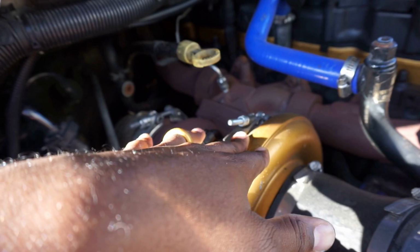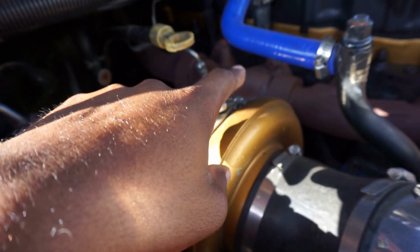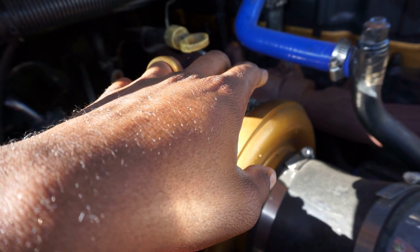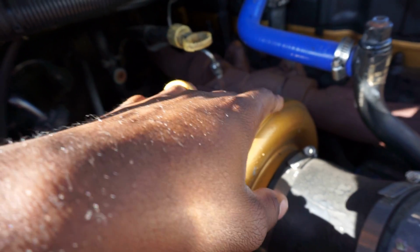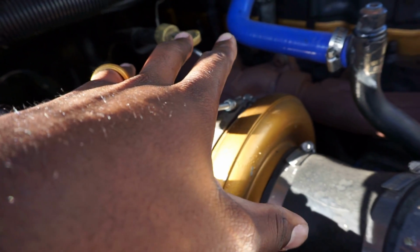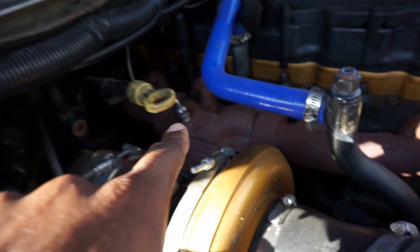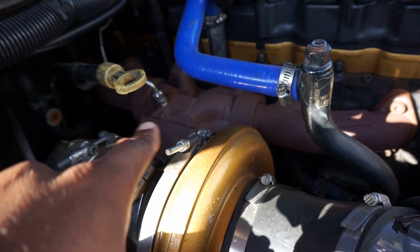467 is going to be good for up to 800 horsepower. I do have a billet wheel on here, and then the 64s, I believe, are good up to 650, 700 horsepower. We're nowhere near that goal yet, so I'm not even worried about numbers like that. We got, obviously, the cold air intake setup that comes with it. Smeding Diesel three-piece, second-gen manifold.